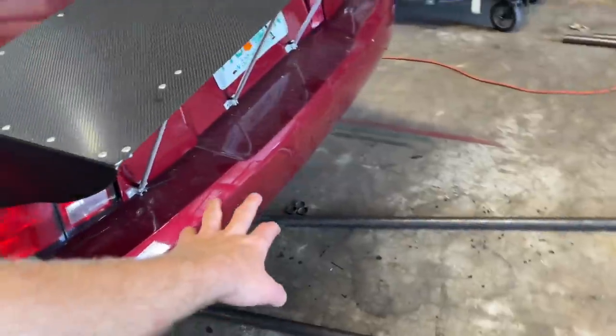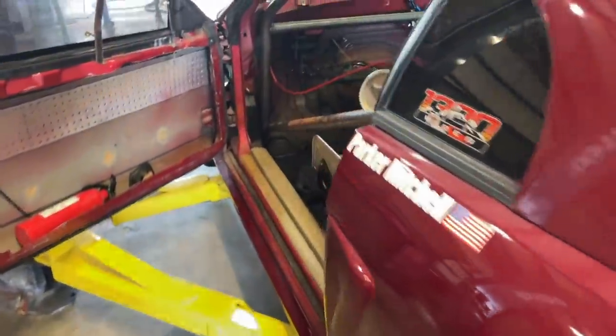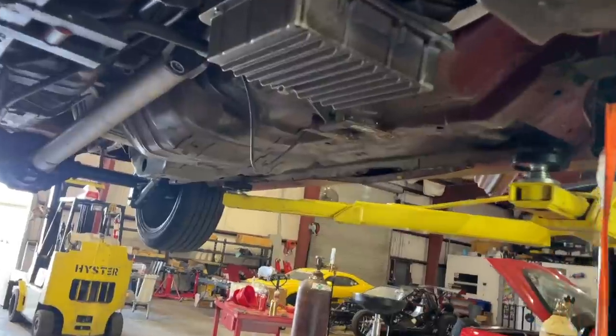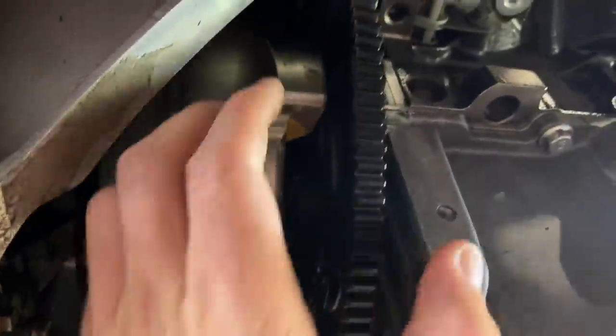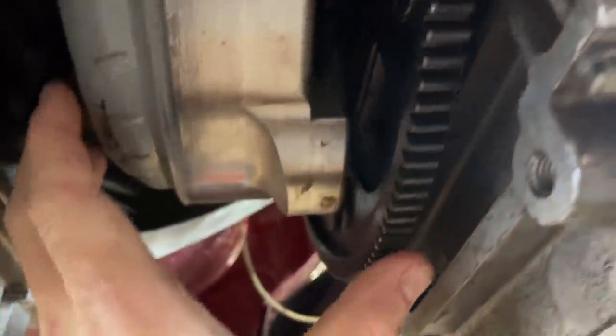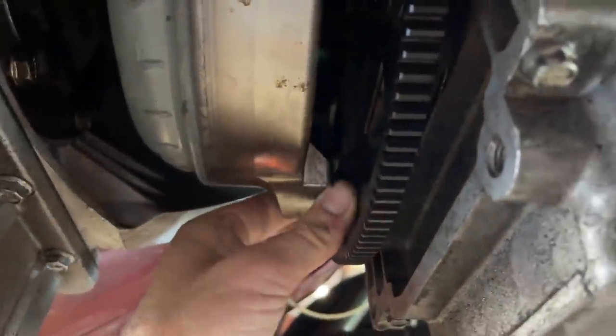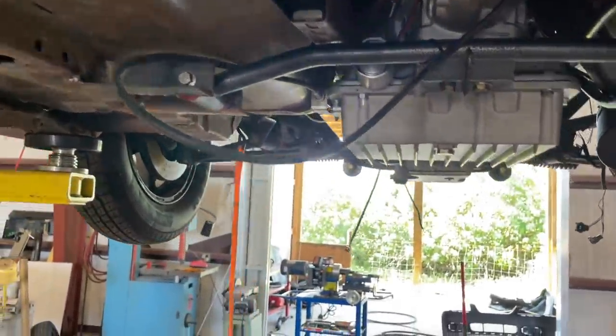Today my plan is to get the rear bumper cover off so that Ty can weld on the Motion Raceworks parachute kit, paint the cage, get the starter hooked back up, and the converter. I have to get this converter re-bolted up to the flywheel — it needs to have about three sixteenths of an inch of movement from the converter being all the way back to touching the flywheel. I've got a little more gap so I'm going to space it out with some washers. I also need to button up the shift line — it's a little long and hanging really low, which is not safe.